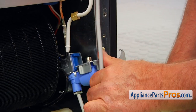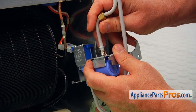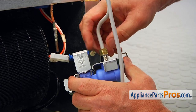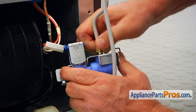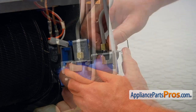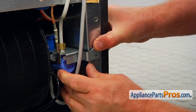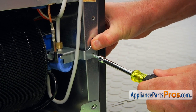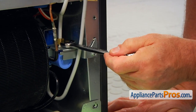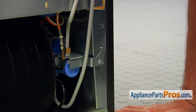We're going to place it in. Now the inline — I'm going to push it in and lower down the nut and start screwing it on, turning it clockwise. I'm going to tighten it manually as far as I can. I'm going to place the valve in — this little hook goes into this opening right there. Hold it in. We're going to secure it with this quarter-inch screw. Now I'm going to use a half-inch open-end wrench and tighten the nut. Don't over-tighten because we're dealing with plastic.